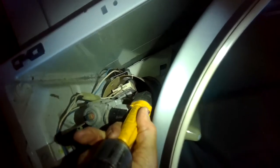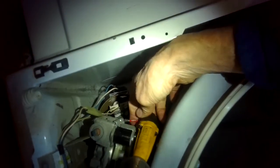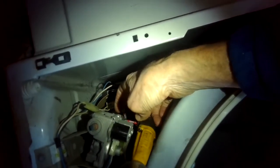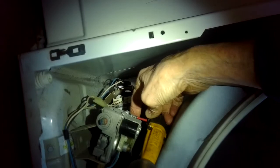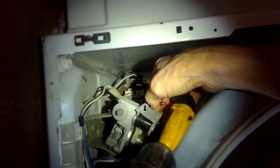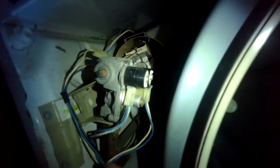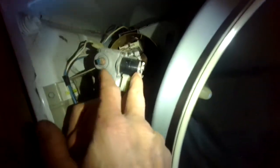First thing to check is for an obstructed vent tube, and if that looks fine, you look for that glow to make sure that the igniting system works. If you get a flame, but you're still not getting much heat, that means these things have worn out, which is very common. So we're going to replace this bigger, fatter one first.